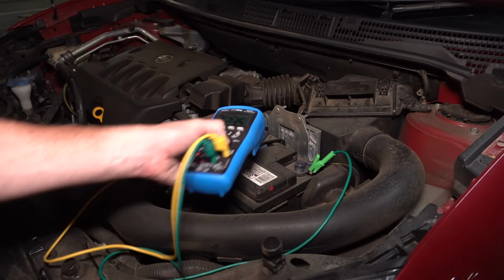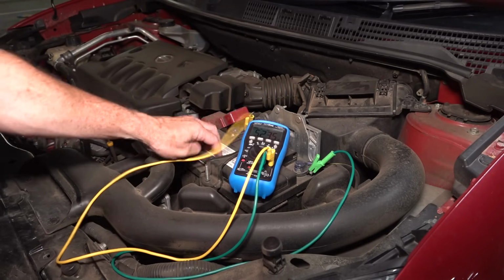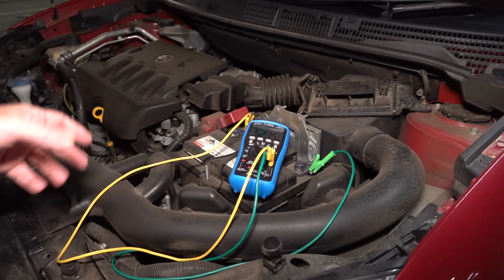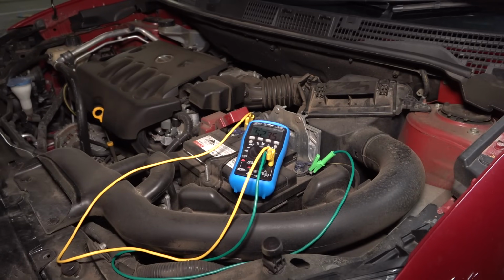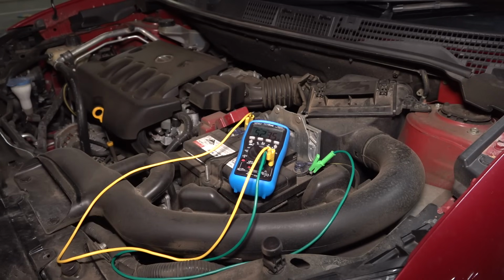She's cactus. Anyway, I assume maybe the alternator's gone and that's why the battery's dead. Who knows? Anyway, it happens. Even EVs still have good old-fashioned lead-acid batteries in them for all the accessories. All the accessories still run on 12 volts, but they have a periodic top-up. My EV actually tops up every day or every few days or something. It'll just sit in the background and use the EV battery to recharge this, because it doesn't have an alternator, of course. So, yeah, anyway, dead ski.